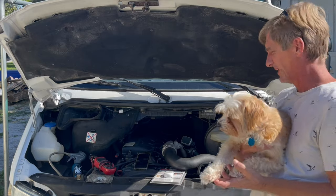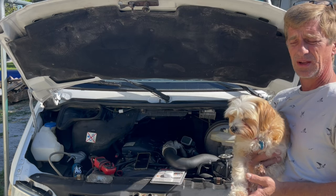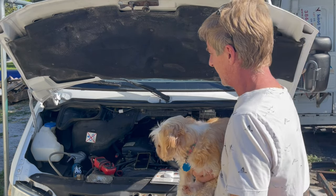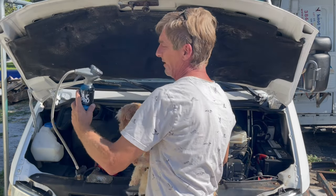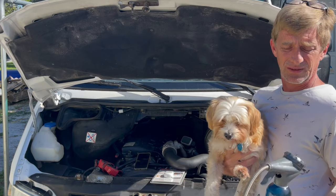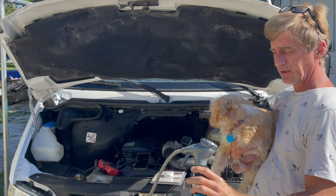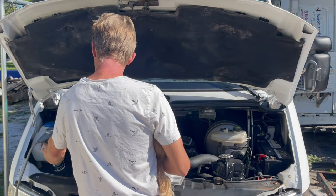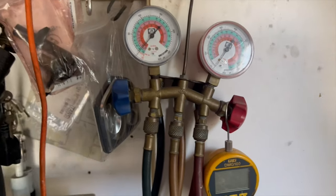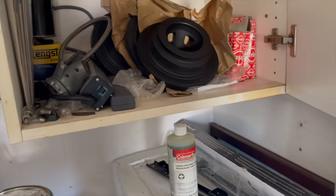We're going to use that today to look at the live data in the van — pressures, temperatures, switches, all of that kind of stuff — and we'll be able to look at it on our telephone via that dongle. We're also going to use little Freon recharge kits. I've got the more expensive meters and gauges, and frankly Butters doesn't know how to use them, so we're just going to use the gauge right on top of this can. I'm not even going to add any Freon to it because we know it's in good shape. Might also use a voltmeter, but this works pretty good for what I'm doing — probably what you're doing too.